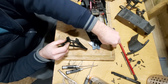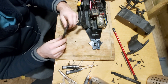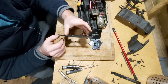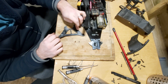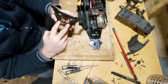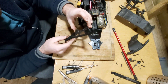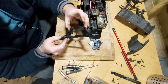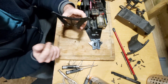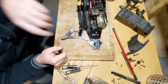So now we've got everything apart. The good news is I haven't actually broken anything apart from one little bolt - that was the rear wing mount, so that's broken. This has got a lovely bow in it, and as you can see it nicely rocks. Now it's worth noting that two of the screws from the bottom here had actually pulled through a little bit, but they did thread out the plastic fine. I'm not sure if they actually just worked loose rather than pulled through. But if they haven't got very good threads when they go back in, I might just put a longer bolt through with a nut on the other side because I do have some lying around. So only one broken bolt - not a big deal. Got loads of spare bolts.